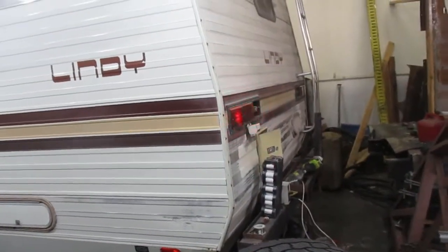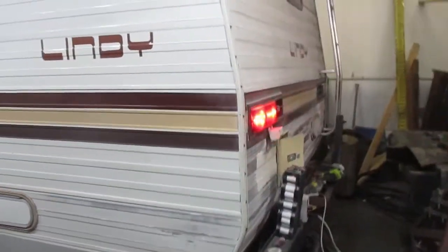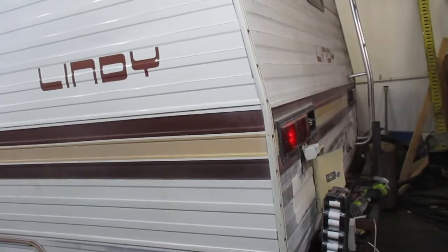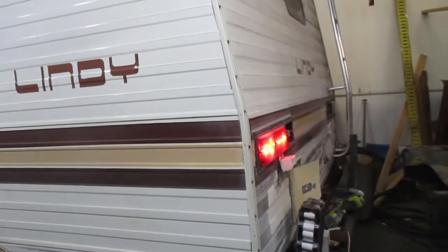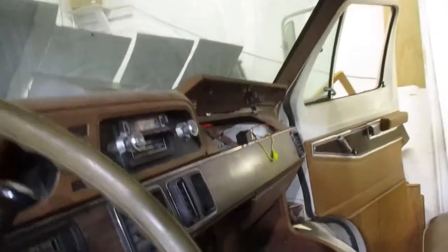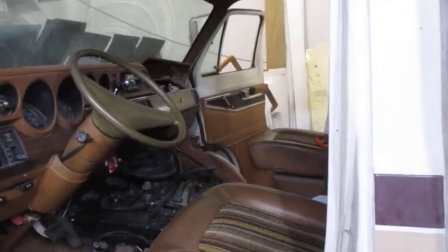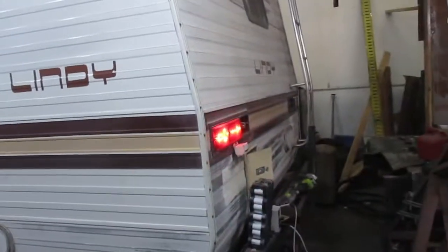So the other thing to note is that the flasher is not going to work with LED lights, because this is an old car and it uses a flasher that's designed to detect the high current that goes to the incandescent bulbs. So I just took the 5-prong flasher and just wired it up. You don't need to do that. I just ordered some regular flashers for electronics, for LEDs, 2-prong ones, so I'll just put them in once I get them. But I'm done. All I gotta do is plug in those flashers, so well, there you go. Hope that helps someone.